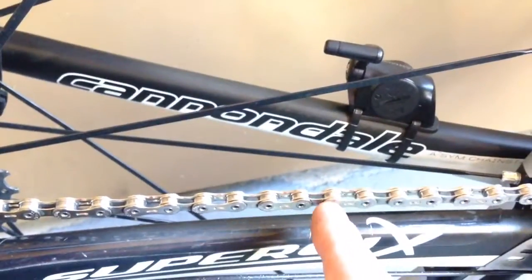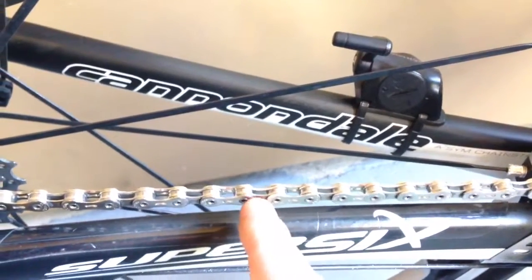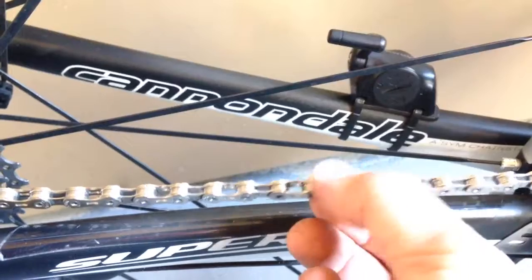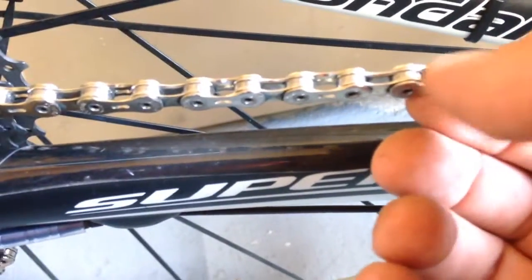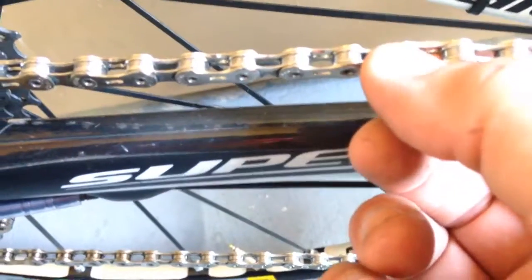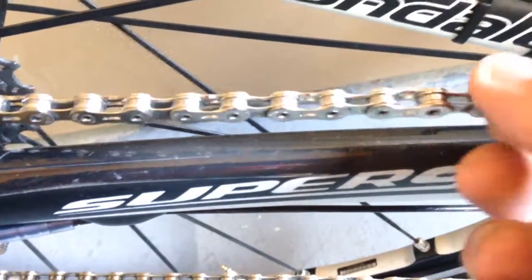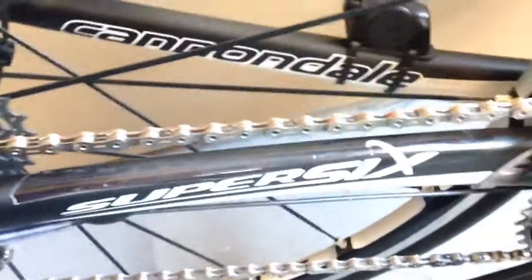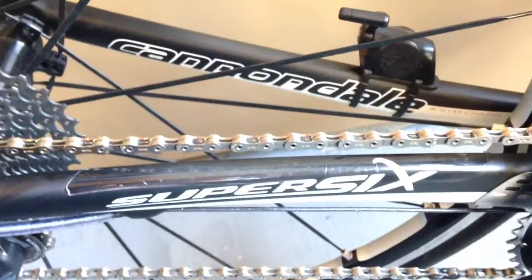After drying, I try to get at least one drop of lube on each one of the chain links. It moves freely right now, but if you roll your finger you can actually feel the rollers in the middle moving. Problem is, if I don't lube them with all the dust and crap out here, they'll start to seize up and that hinders performance.